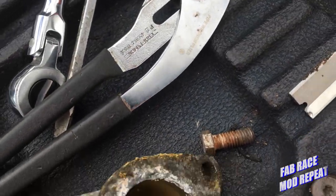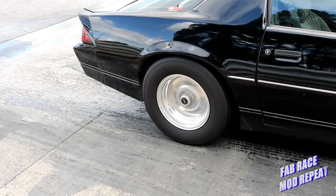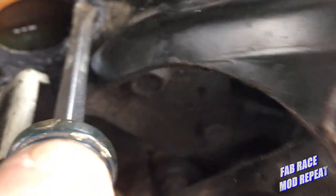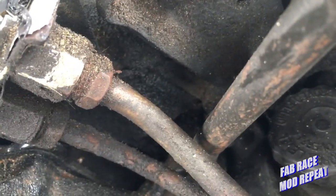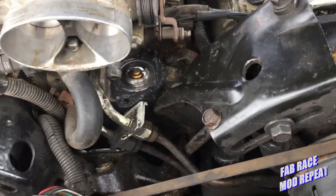The stat was actually pretty clean. Now if I can just get all the hoses back on without incident, we'll have it made. I got it clean and we'll put a little layer of RTV, just because there's some pitting in the aluminum, just to make sure we don't get any leaks — hopefully. It's always kind of a hit or miss with these. I got to get the thermostat in there; you want to try to keep the hole as cleaned out as you can. We're going to use the Fel-Pro self-sealing gasket along with the RTV.